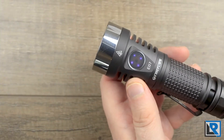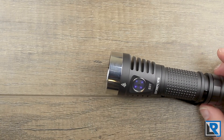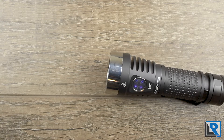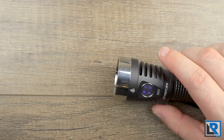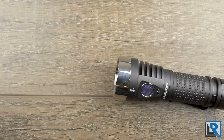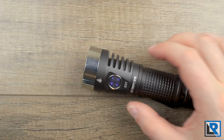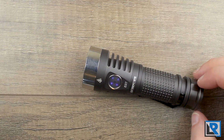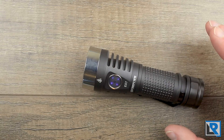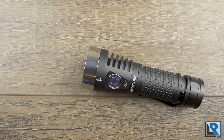This light is small and compact with a lot of LEDs, and it gets really hot. Having the Nichia emitters doesn't help. On turbo, it heats up super quickly — in under two minutes I saw temperatures of 61°C (142°F) in the head area, which is approaching an uncomfortable temperature to hold. The light does spread heat down the body and into the tail cap. Luckily, you can adjust the thermals in the UI to make it more aggressive on step-down if you wish.